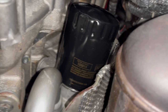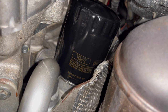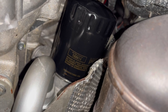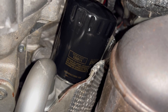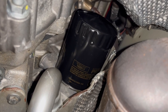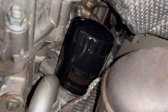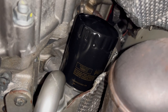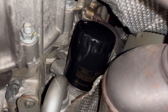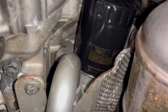As far as I know, there is no aftermarket oil filter available for this engine. You have to get it from a Maserati dealership, if you want to pay a lot of money, or buy it from two parts websites: one is Scuderia and the other is Eurospares. I'll include links in the video description below — that would be a great place to verify what part number applies to your vehicle. You can find oil filters on eBay as well, but I question if they're genuine, since there are a lot of counterfeit auto parts on eBay. Be sure you get that correct part number for a dry sump oiling system.